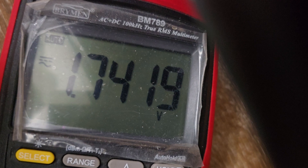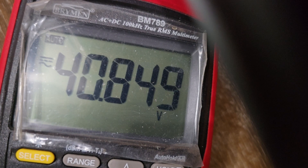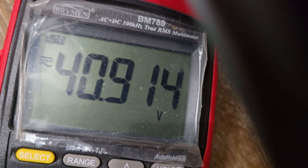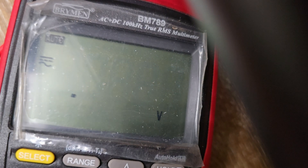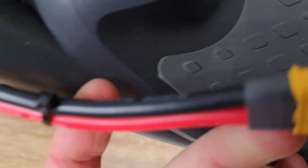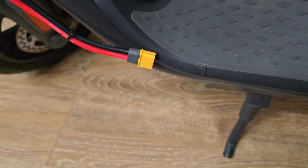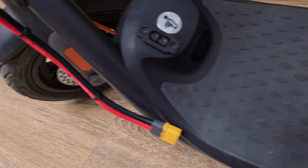Let me verify the voltages. The built-in battery is at 40.85 volts, and the additional battery is very very close — just 100ths of a volt difference. I think we can plug it in and it won't spark. For wiring I'm using 10 AWG for the main output, about 70 centimeters in length. Let's connect the batteries — and it's deadly quiet, no spark.